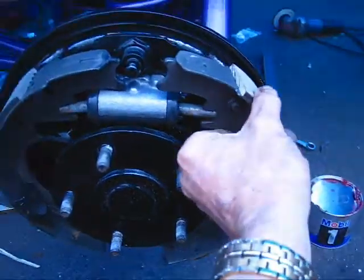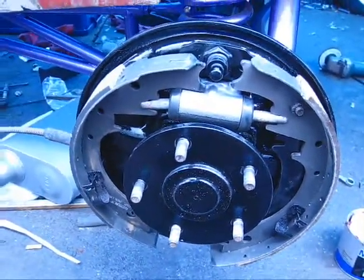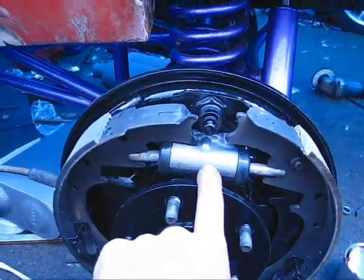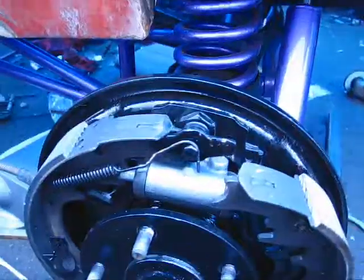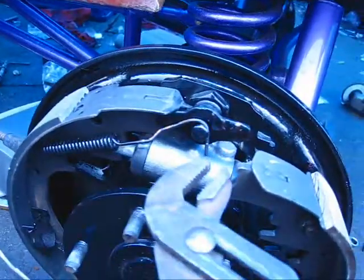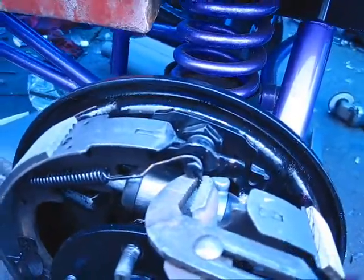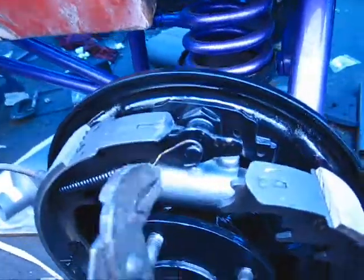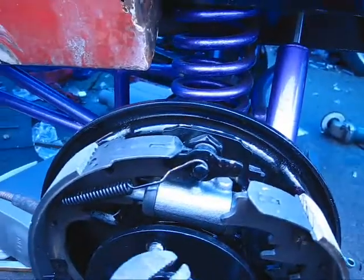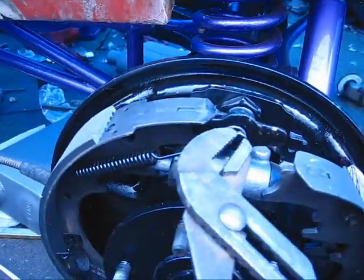I just hung my brakes in here. Now I'm going to slide them forward and the first thing I'm going to do is put my springs on — they hold this wheel cylinder closed. What I've done is put the spring in through the back of the brake and hooked it over this pin, and now I just twist it to — actually that little brake spring broke there.